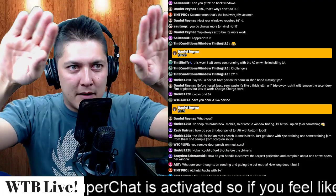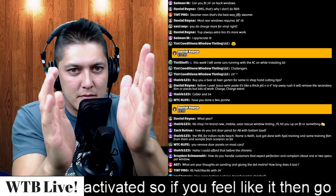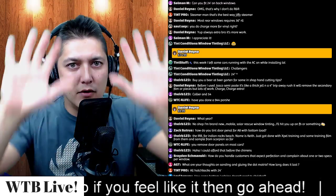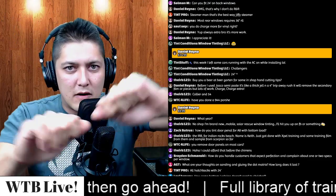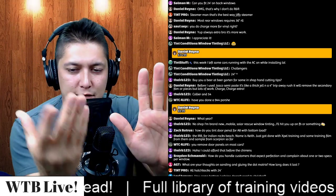So you go from the top and then you go down. When you're doing that, you're bunching all the film to the bottom, which will produce a finger, right? But when you bottom load, you bring the film in, and all the film is touching the glass. And if you spread out from the center out, then you're not squeegeeing down and forcing fingers to group up